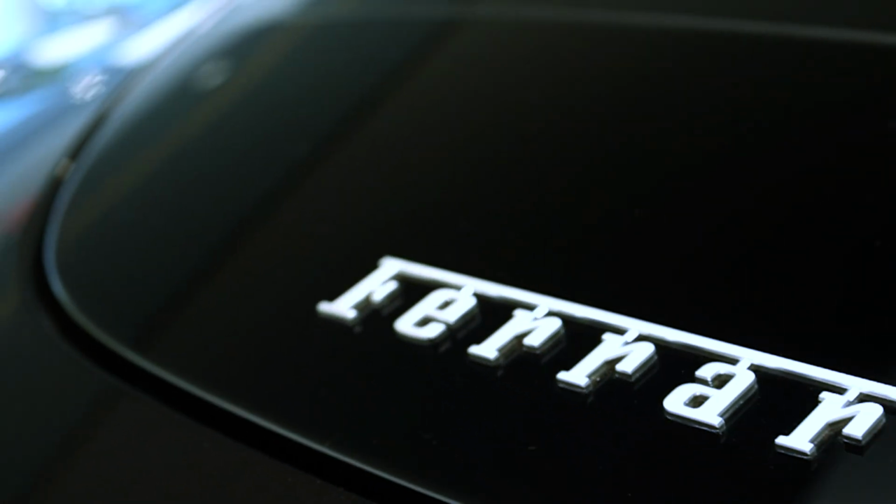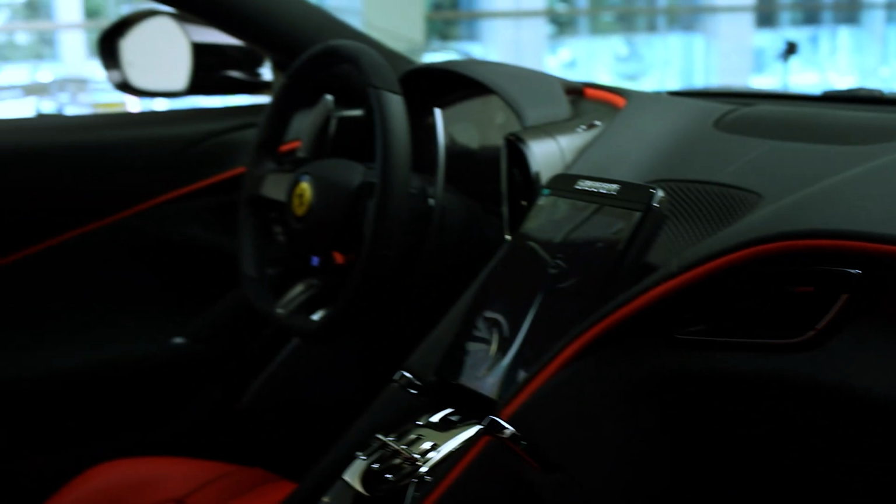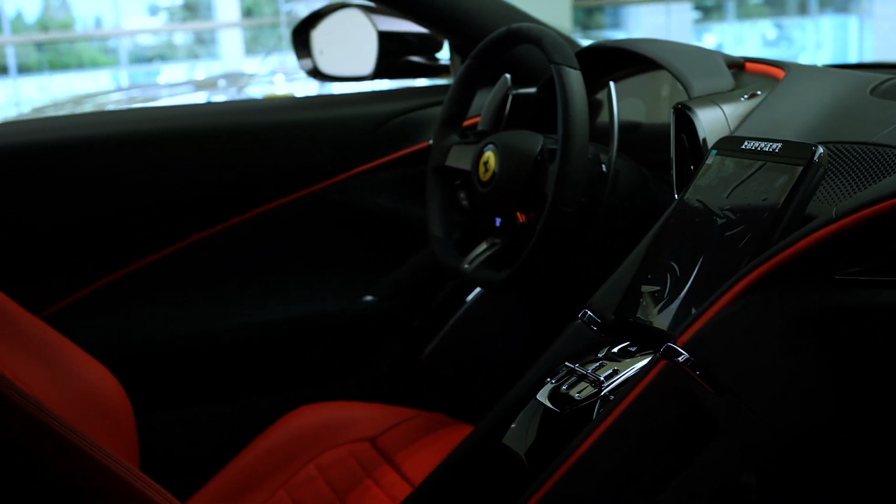The exhaust is an all-new design featuring the removal of the 2 rear silencers as well as some ovular bypass valves to reduce the exhaust back pressure and valve control that varies based on the driving mode that you select. This gives you a bespoke sound quality to the Roma as well as some added performance benefits.